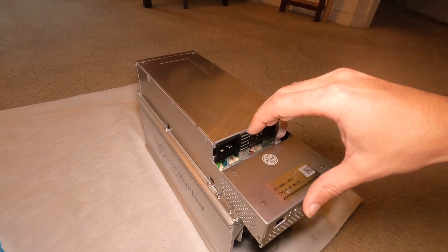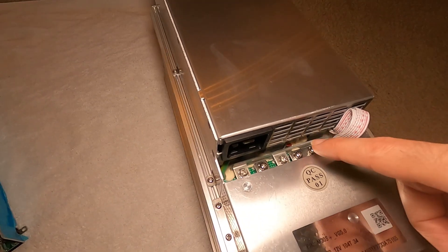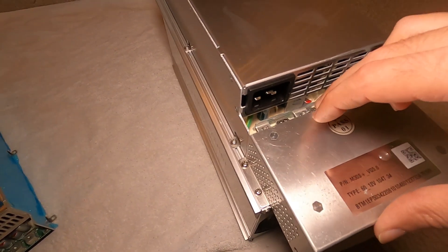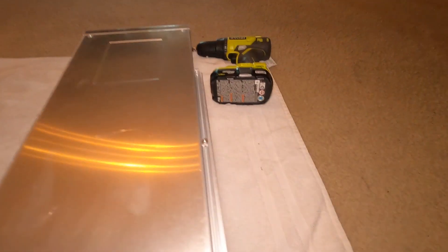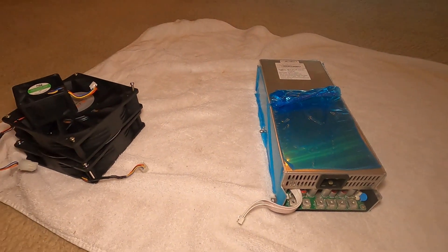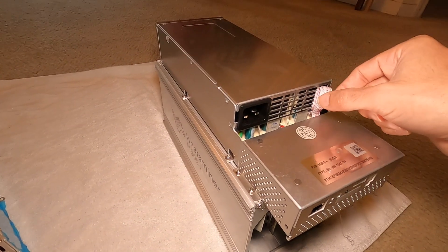I'm not going to take you along the entire journey, but we need to first remove the control board, because these power supplies are connected to their miners via bus bars — not your traditional 8-pin or 6-pin power that you'd see on old S9s. It's just four screws, two on each side, to lift the front section up — I showed that in a previous video when we were replacing the adapter board. Then once I remove the screws connecting the bus bar, it's just a couple of screws on either side to remove the power supply from the miner. My first goal is to crack this one open and see if I can get to that cable, then grab or remove it from the old power supply.